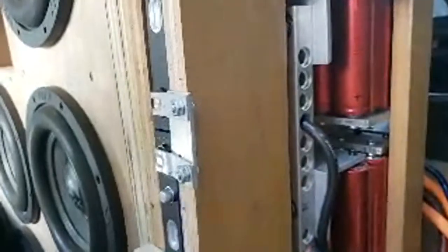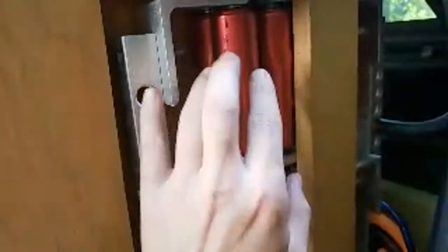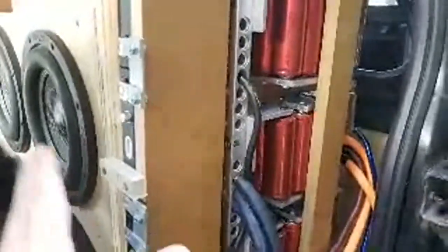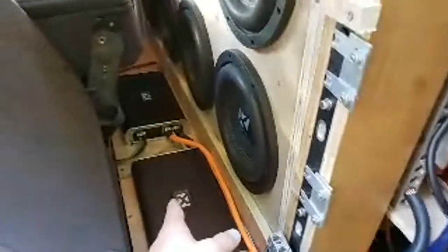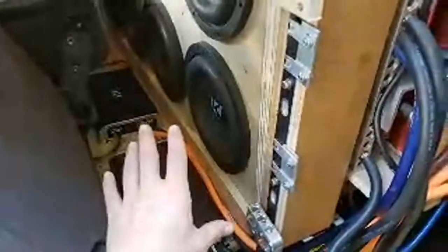LTO is definitely safer. I believe some of the B2 batteries actually had these Headway cells in them. As for alternators, I just have the factory stock 110-amp alternator on this truck — it doesn't put out anywhere near 110 amps anymore — and I'm still able to hold 12.4–12.5 volts with this setup.